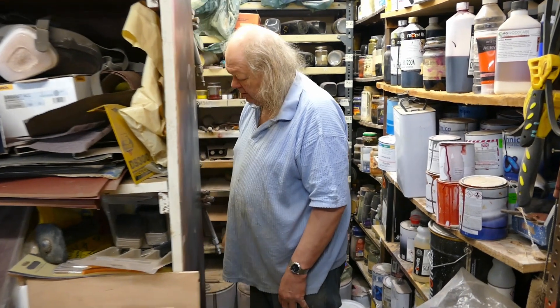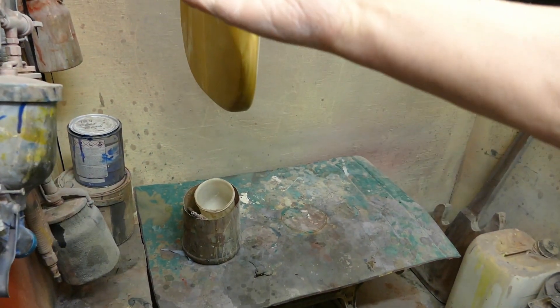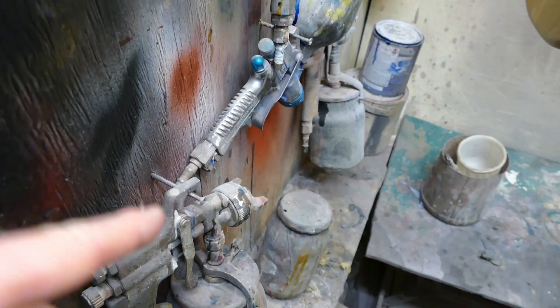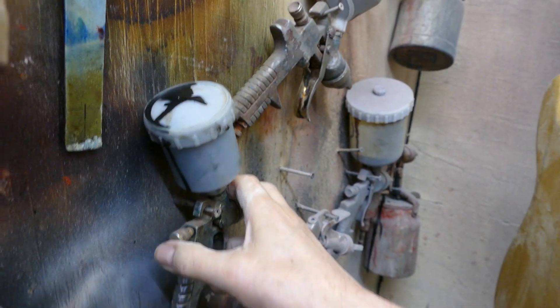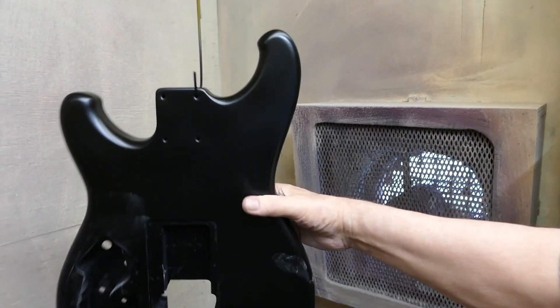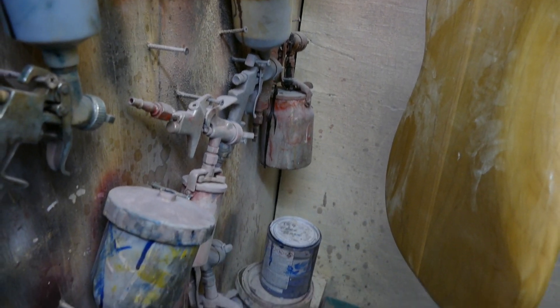So that's done - it's ready to have its white base coat upon it, which I'll do today. When I've reassembled that gun, which is soaking in thinners. Can't you choose another one? Yes, I could, but they've all got different coloured paints in. That one's got clear lacquer. There's a hooking system - clear lacquer, black, blue. That's base coat - that's that stuff I've put on there. This is the black that I'm spraying that with. I'm using the little gun because I've had to put additives in it. When I came to respraying this black, I did ask him if he'd been using any silicone on it - he said no. But there was silicone all over it and all the paint finish bubbled up everywhere. So I had to flat it all back down again. Now it sticks and it's even.